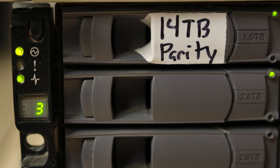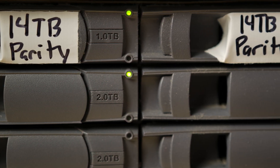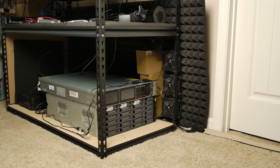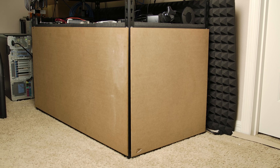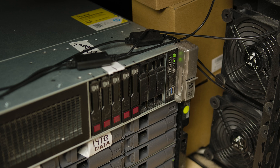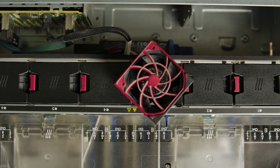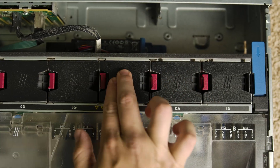You've probably noticed that I've had all this B-roll muted, and that's for a good reason — it's loud. Rack mount units like this aren't made to sit in an office or under your desk, so companies aren't worried about keeping them quiet for everyday use. So if you're thinking about building a similar solution, don't think you can get away with putting it in your bedroom. Mine is in a separate room, and I modified a shelf unit with some walls and added lots of soundproof foam to keep the noise down. I have 120mm fans, which are much quieter than the server's own, bringing in fresh air directly in front of the server and disk shelf to keep the whole thing cool.